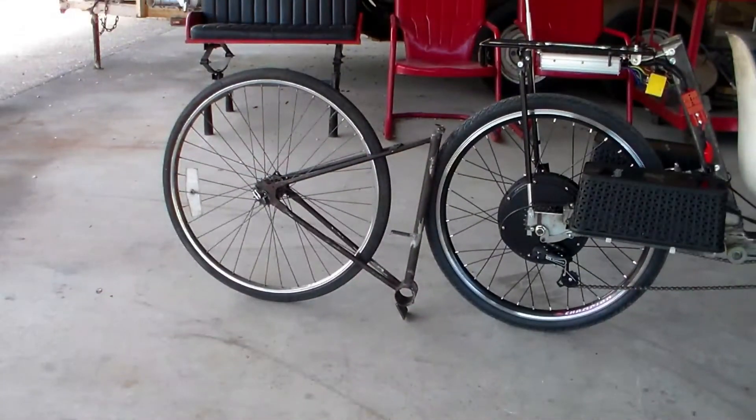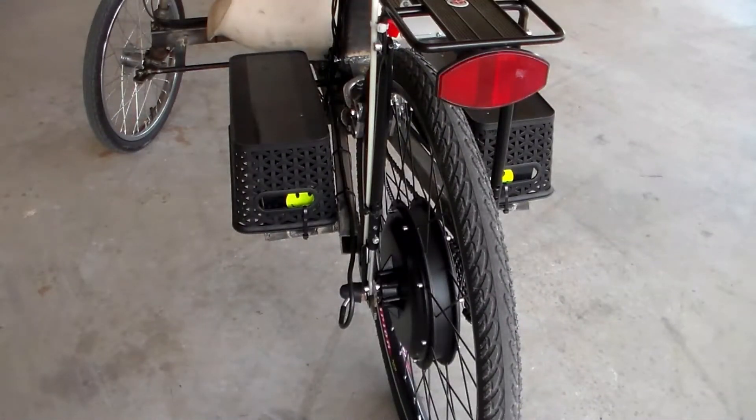Something you'll notice is I removed that back half of the bicycle that I originally had put on the frame. I built my own rear arm set for the rear wheel, and that took a little bit of doing because you had to get it level so your wheel wouldn't be tilted left or right — it'd be running center.